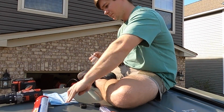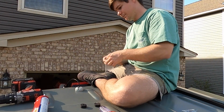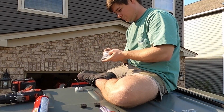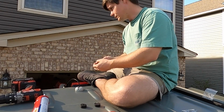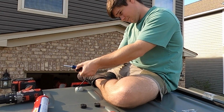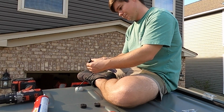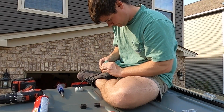and basically we'll just adjust the backup settings on the display of the head unit once we get where we can put the parking lines basically to get you centered in a parking space setup. But the bracket itself, super easy install, just 4 little Phillips head screws that hold it in, and then 2 little screws that hold the camera onto the bracket itself. So it was a super easy install.